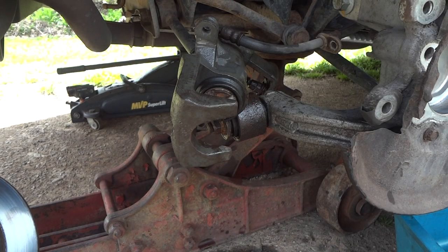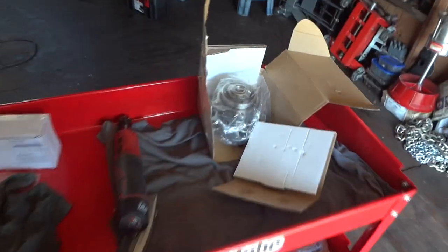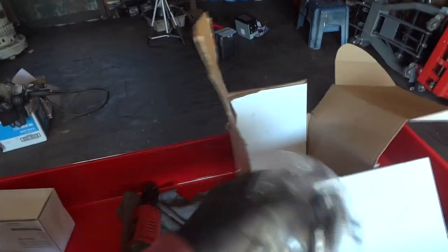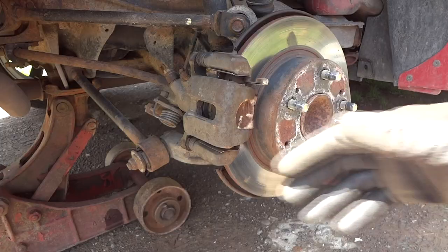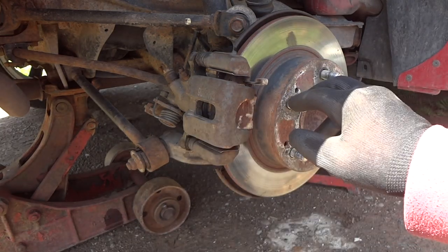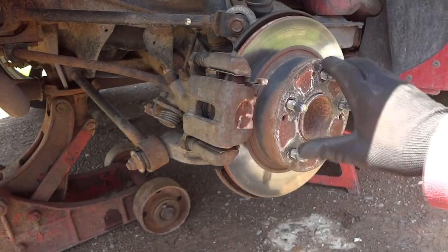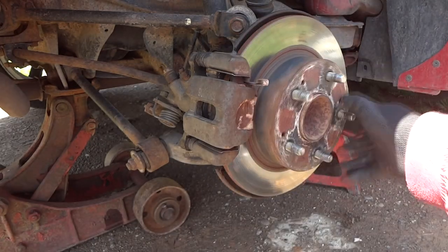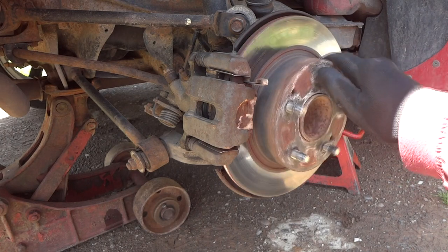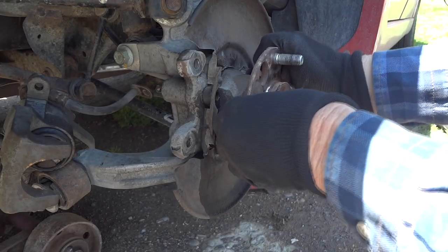The caliper's good. Just like that, we have our wheel bearing - I had to order a new one and it came in about three days, surprisingly fast. We'll go ahead and stick this one on and hopefully wrap up the video shortly. Before putting this on, I stuck the old wheel bearing back on and drove it to verify the rotors and caliper weren't freezing up anymore. The caliper is not frozen up anymore - it's working just like it's supposed to be.